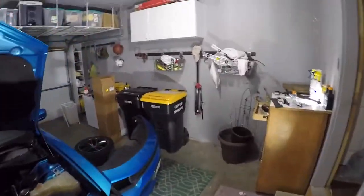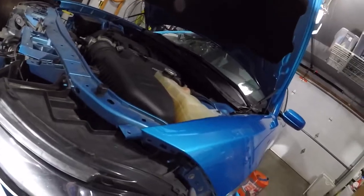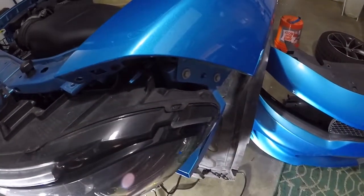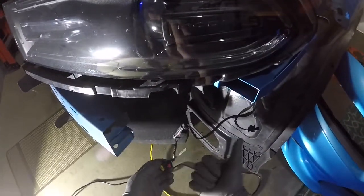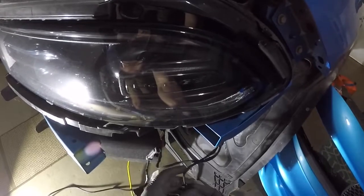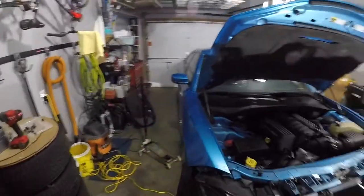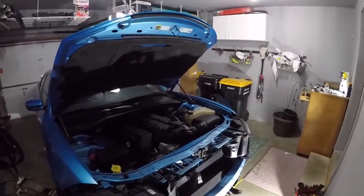Alright, I did that same thing on the passenger side. On the driver side there's one bolt up here and then two that go up to here, plus those plastic clips. This one goes to your fog lights — you click it back toward the rear of the car and then unplug it. This other plug you just stick a screwdriver in to pry it up and it pulls right out. Those are my only two connections. The headlights stay in place and the whole bumper just pulls right off. There were really no clips at all, it was all bolts — it just slid right off.